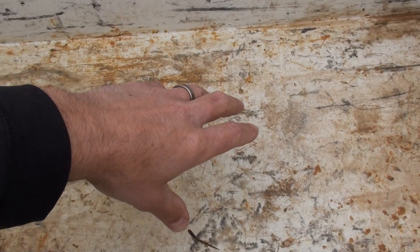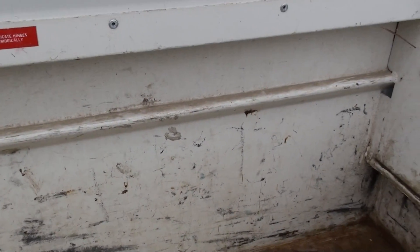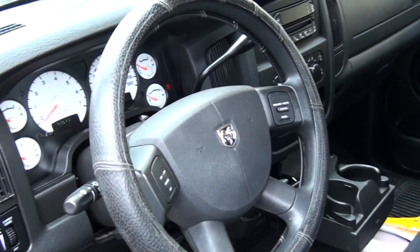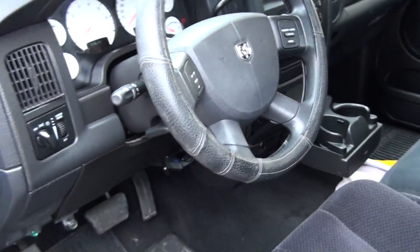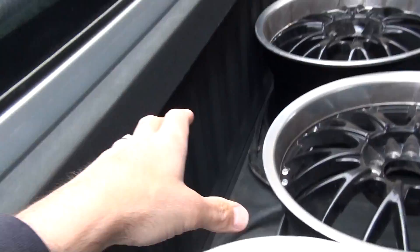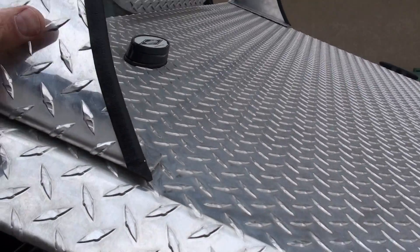The Weather Guard box is about four feet wide, and I'm going to clean it up and give it a nice coat of paint. We'll have the tank in here and a 144-plate generator on either side, with all the equipment mounted up against the back. I'm hoping to put remotes on the PWMs so I'll have a box up in the cab where I can see the amperage on each PWM and control the duty cycle. That box will be mounted up front and concealed with a lid.